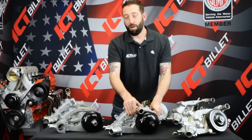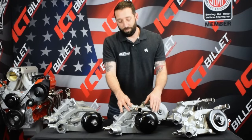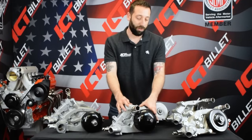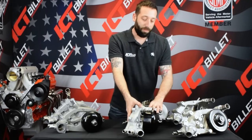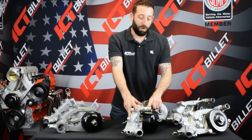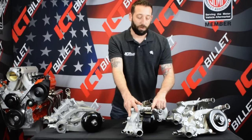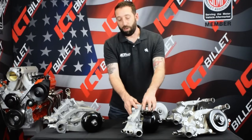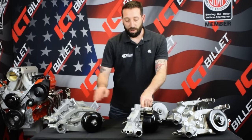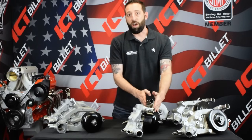This is the LS1 pump off a 98-02 Camaro — most common on any swap and fairly cheap to buy compared to some of the LS3 pumps. The pulley is really wide on this one. These were used on LS1 Corvette and Camaro — the Corvette ran on the back side of the pulley, and the 98-02 Camaro ran on the front. We typically use these on all the truck brackets as well because it doesn't have this neck exiting high, so it looks a lot better. We'll just put water pump spacers behind it to bring it out and line it up with the truck.